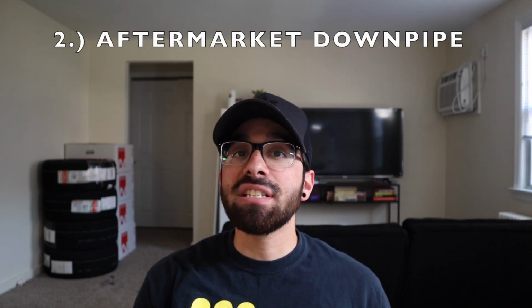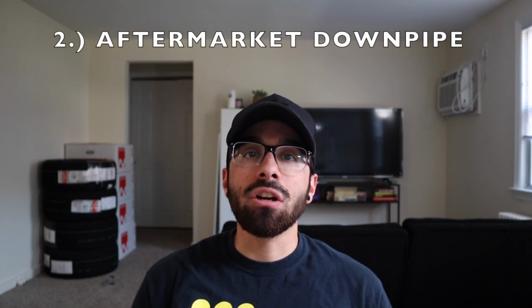I recommend one of the next mods you're going to want to do is a downpipe. Now, in the previous segment of the video, I talked about how if you just want to get a tune done and keep your car pretty much stock, you could get a stage 1 tune, flash it, and you're good to go. Once you start getting into a downpipe, an exhaust, intercooler, and intake, which we're going to be talking about further on in the video, that's when you're going to want to move to a stage 2 or higher tune.